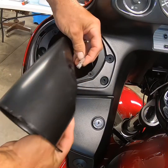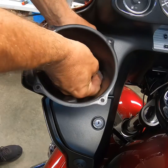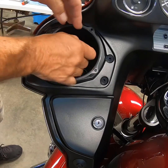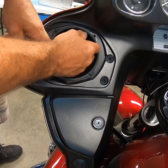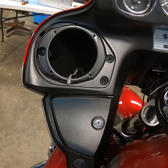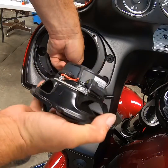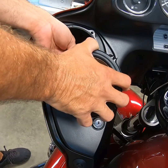Time for reassembly. Speaker wires through the little hole — grab them and pull them up. Make sure you don't knock those little screw tabs down into your fairing, or you will be either tearing it apart or doing what I did and going with three screws — which actually hold it in quite well, so there's no problem with the sound. Grab the new speaker; since we've already determined positive and negative, put the wires on.